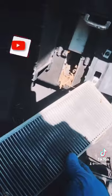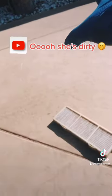We take off this little cover, another little cover, and then boom — we have access to the cabin filters. I've got two in this one, and these are dirty. The first thing you want to do is toss these out.